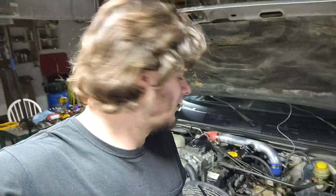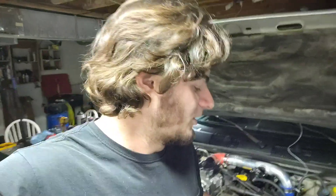Welcome back to the channel. I'm back at it again with the Supercharged Grand Cherokee. Today I'm going to be installing the Innovate Wideband. So far I've been having to guess because I can't get the data logger to work with HP Tuners, so I've kind of been looking at the MAP voltage and the long-term short-term stuff. But that only works in vacuum because you don't want to be trying to lean it out under boost. Everywhere else I've just been absolutely guessing on how it feels, which is kind of dangerous with a boosted vehicle — but it's only five pounds of boost, so it's really not that crazy.